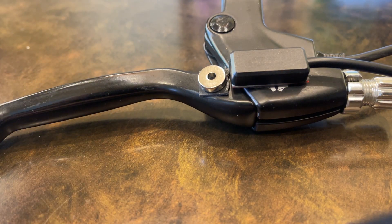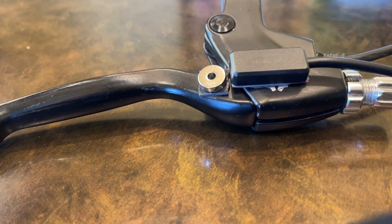Electric E-Bike Pals, I have kind of worked out a solution for the problem that we've had with coming up with brake lights for an electric bike without getting involved in anything that endangers the controller. So on your electric e-bike, you have motor cutoff switches, and those switches have a 5-volt signal that when it closes, that is what the motor knows to shut down.